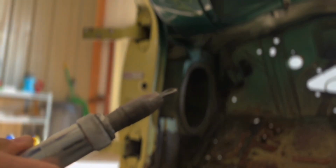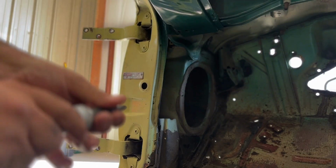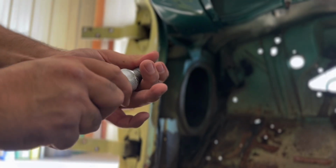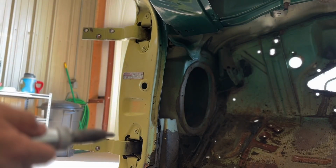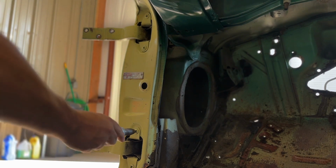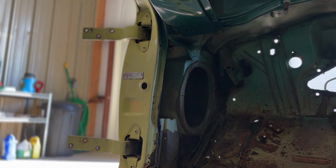If you don't know the way this works, it has a pivoting head, which if you turn it one way, it tightens, it goes to the right. And if you turn it the other way, which is the way we want it, it turns to the left. So put it on there, hold it firmly, and then hit it with the hammer. And it'll spin it little by little to knock out these tough screws that you can't get out with a regular screwdriver.